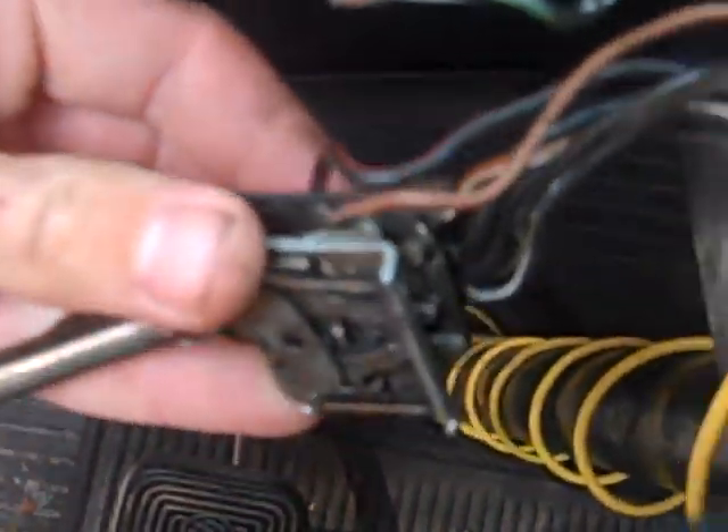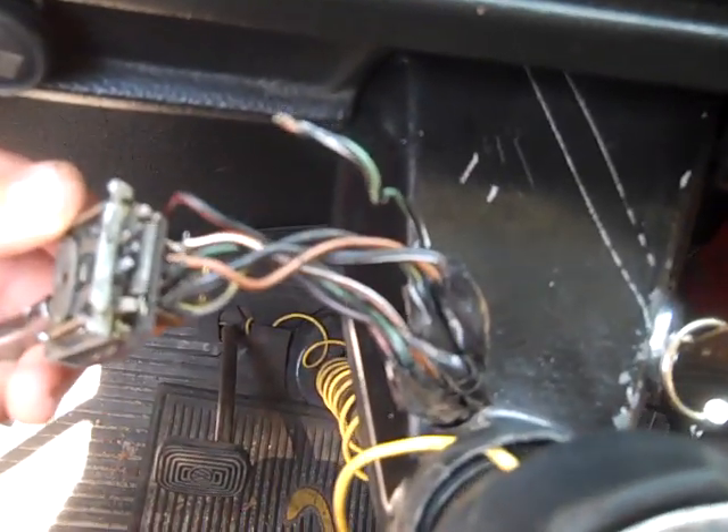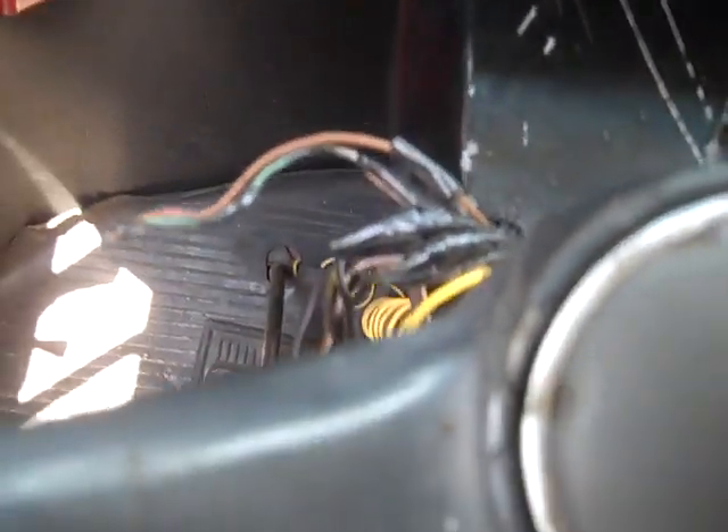The problem I was having is that it wasn't working at all. When I got in here and started pulling it apart, I went to a junkyard and pulled out a second switch — that's from a '74, it has fewer wires than mine does. I got in here and realized the previous guy had replaced this switch but didn't feel like pulling the wires out and putting in new ones, so he hog-pinned them all together. Same color assemblies though — brown and white is brown and white, and so forth.